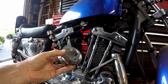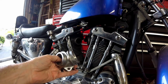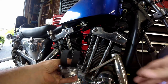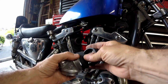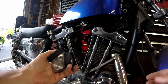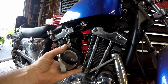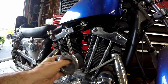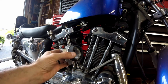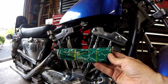In order to get this manifold on the motorcycle, this takes the rubber band style, not the O-rings like the early bikes did. You can see the band and the second band — these just go on here like this, pretty simple. I decided to change these because I had extra ones. If you buy a James kit it comes with both styles. I had plenty of bands and they were looking pretty worn, dried and cracked, so it was time.